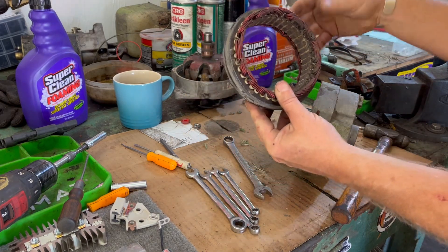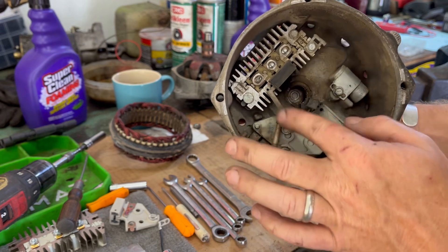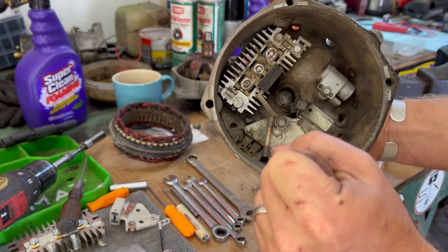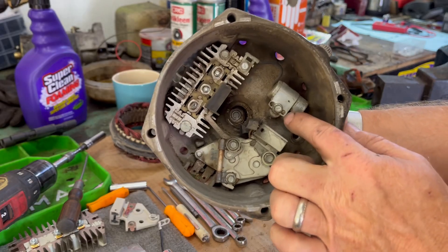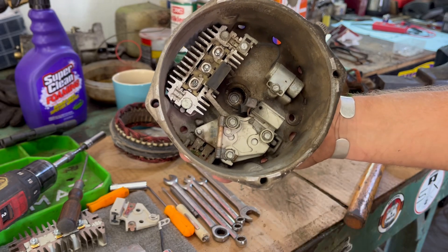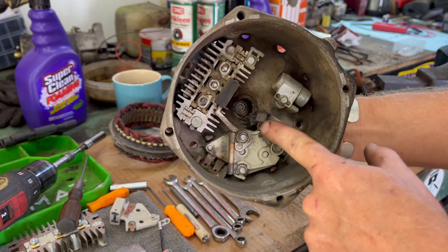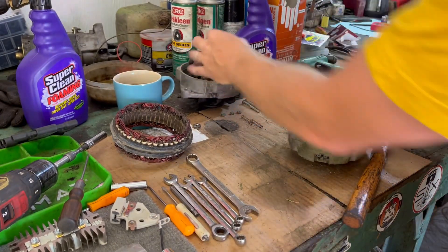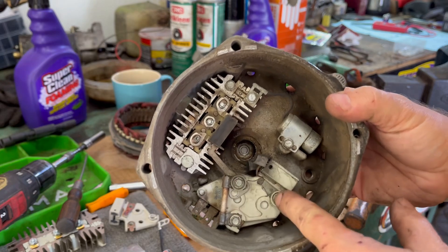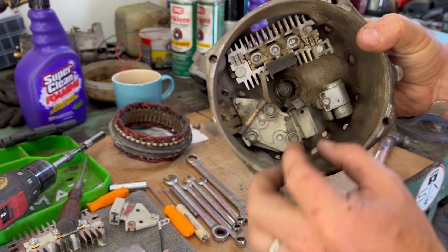Ta-da! Well done. Now we can get a better look in here. This right here is the diode trio — that allows electricity to only flow in one direction, which should be outbound. Behind that, with the fins on it for cooling, that's the rectifier bridge. And then you've got a condenser or capacitor which soaks up all the extra stuff — it does stuff, I can't remember, but don't touch that and go wow, it's lightningy. This is the brushes right here, which ride on this part of the rotor — that's why it looks like something's been rubbing it, because it has. Then behind that, these three screws hold in our voltage regulator, which is really what we're after. This other stuff you'd probably replace too, but it's not strictly necessary.